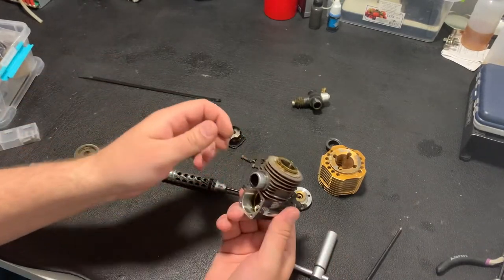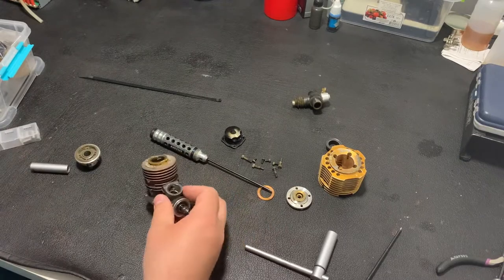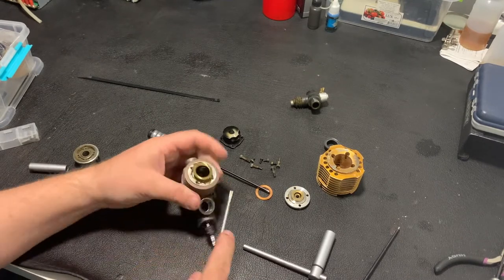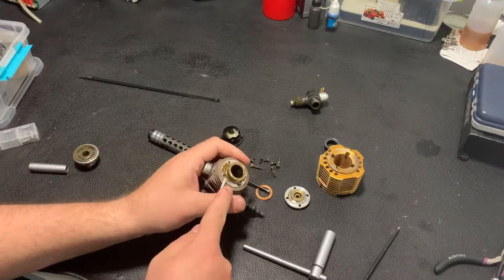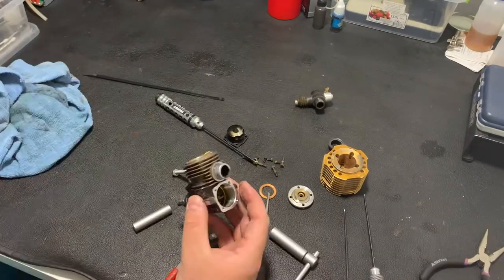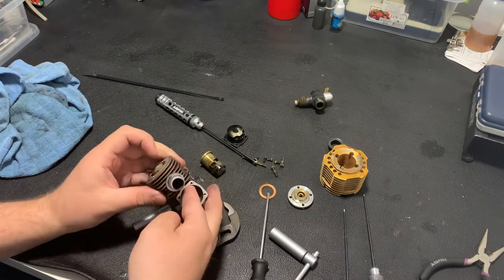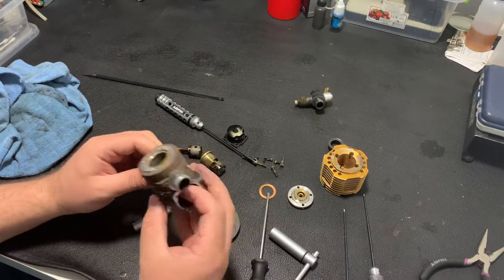And at this point, when the sleeve already goes out of the engine, it's already possible to use a screwdriver to just pull it out. There is nothing dangerous for the engine or for the sleeve at that moment anymore. Now when the sleeve is removed, I can already remove the conrod and piston from the engine. It's much easier than removing the sleeve. Here's the piston.